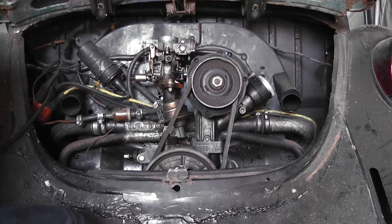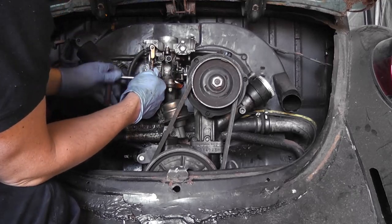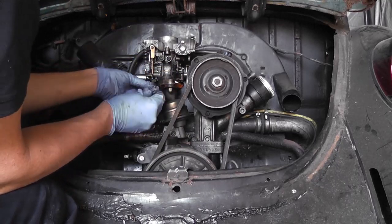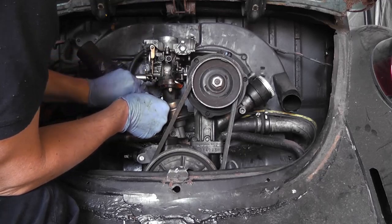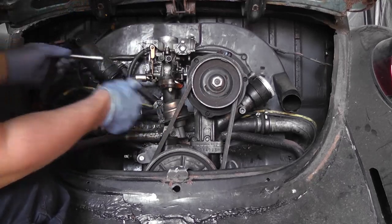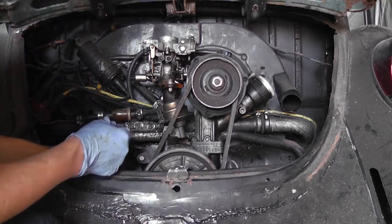I may strip this carburettor before I order a rebuild kit, because there's no point in getting a rebuild kit for a carburettor that's past saving. I'm going to take the accelerator cable out and pull it out there. I'll keep the barrel clip — I'm going to put it back onto the accelerator cable for the moment just so it doesn't go missing. Because I'm going to need to look at a spring for the accelerator pedal linkage.